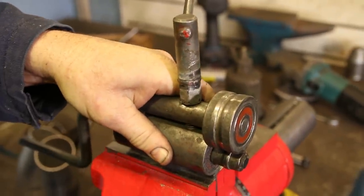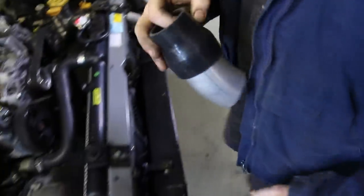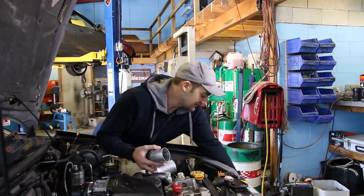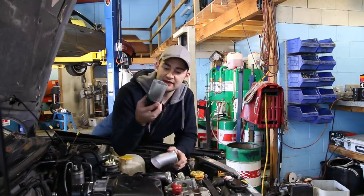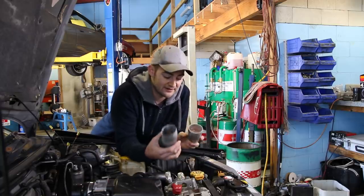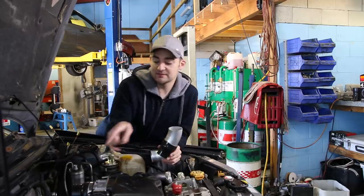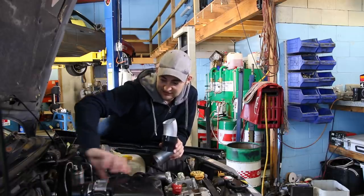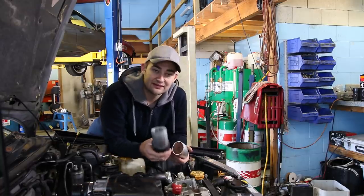We can then use a bead roller to give the silicone and clamp something to grip to. We've got the front mount on there. Turbo Yoda has welded on some aluminium fittings so we can come through the front of the car. He's also made up these so we can kick up the end of the pipe up and out of the way. There's a driver and a passenger one. He's rolled the ends so the silicone will fit over them. Now all we've got to do is map out where the rest of the pipes are going to be - made out of stainless so it looks cool and is easy to fab up. It'll come around from the top of the intake and down into the cooler on both the hot and cold side. And that's our intercooling done.